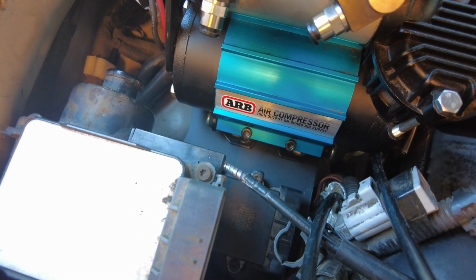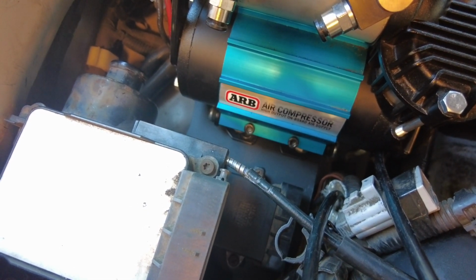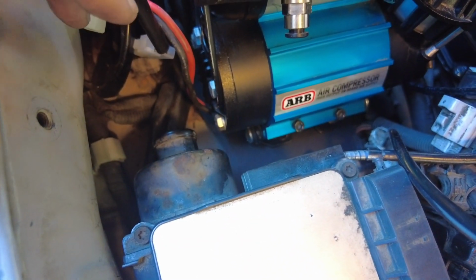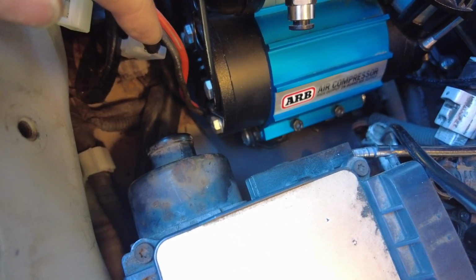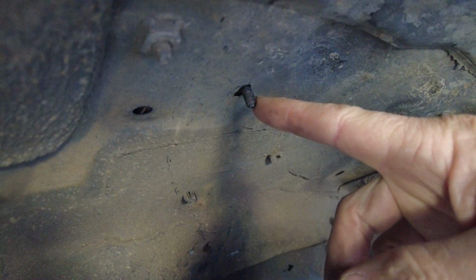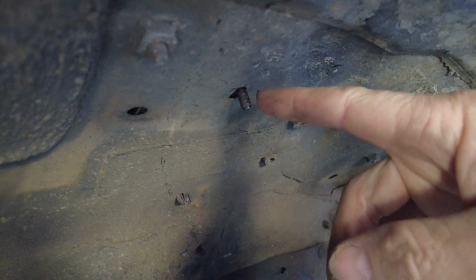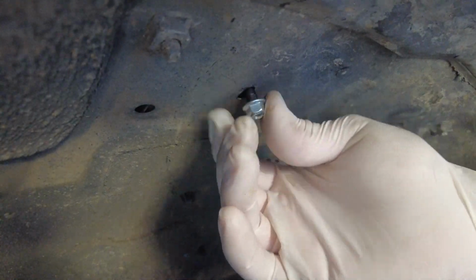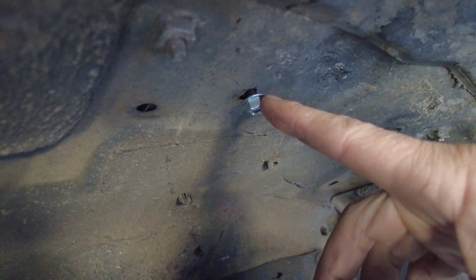Okay, Garrett got that one started. The last fastener we have to connect is in the fender well. The bracket has a stud that slides through that hole for the airbag clip. So you can see the stud sticking through the fender right here, and Garrett's going to spin on the flange nut that the Yota 1 bracket comes with. All right, since we're here, we're going to start off and cinch this one down all the way. We have all the fasteners required for the bracket connected now.